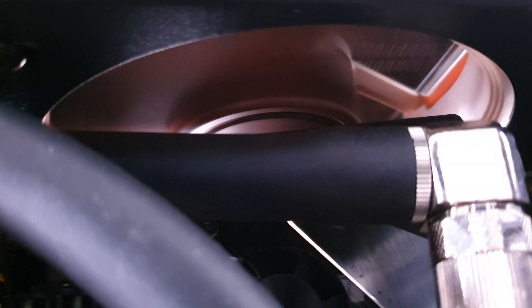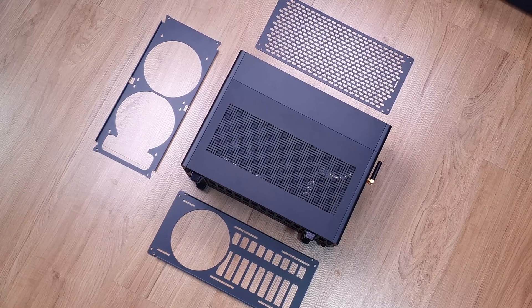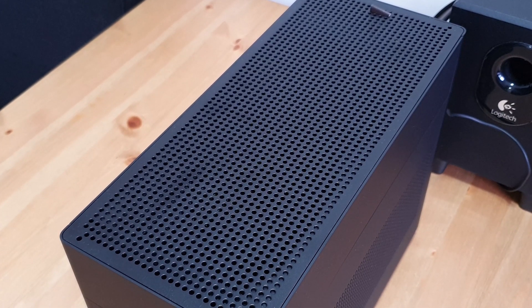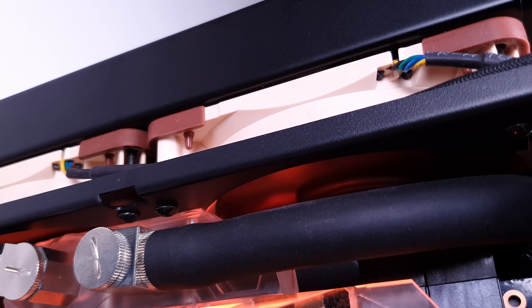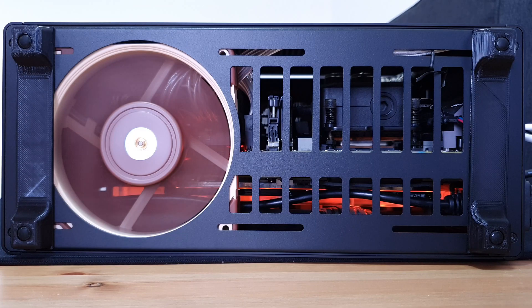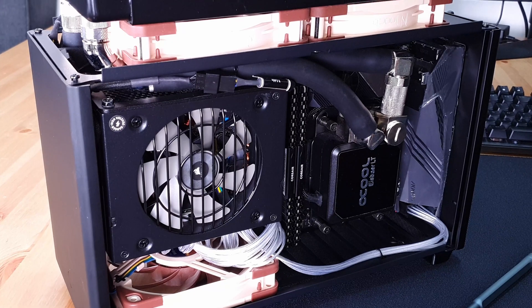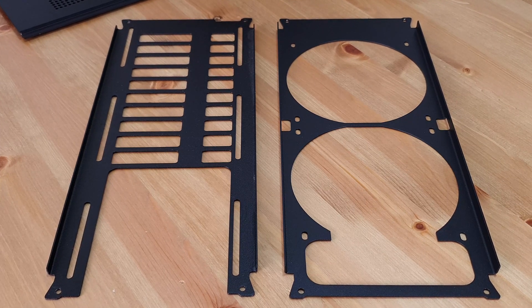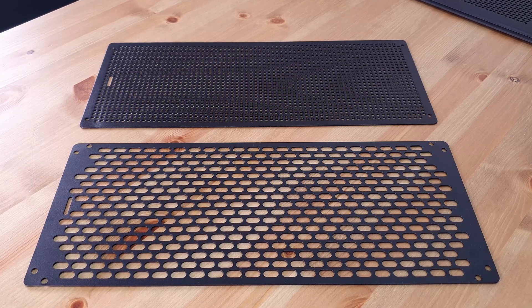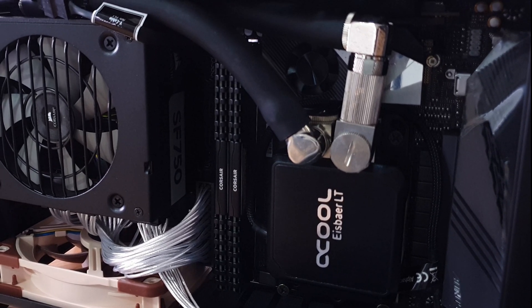In the end, getting the tube to not touch the radiator fan was a challenge, and I didn't have the correct fittings to keep the tubing from flexing upwards, so I had to rely on a zip tie to hold it down. So that's what needs to be done for a reduction of 6 to 9 degrees. I'll leave it up to you to decide if it's worth purchasing these aftermarket brackets. Using the plates and grill that came stock with the case would still give you decent temps, but there is a case to be made for the mount plate for those on a custom loop. The bottom plate I'd only consider for builds that have no problems fitting a full-size fan beneath the power supply. As for my build, I'll continue using all three for the moment. I'm planning to upgrade this build to new hardware and I'm not sure how hot they'll get in this case on a single 240mm rad, so these brackets were one of those things I was looking at to hopefully manage thermals better. Another thing I was looking at was changing the pump to something with a higher flow rate, but we'll save that for the next video.